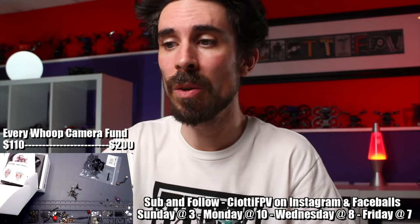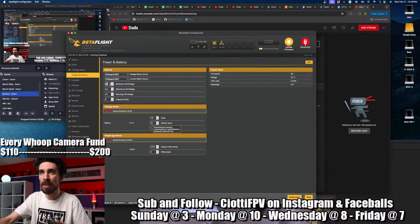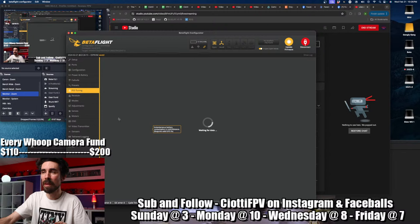I need to go into power and battery, and I'm just going to bump these up. Bump this from 2.9 to 3.0. Bump this from 3.1 to 3.2. I'm going to recommend everybody do that. That's going to keep you from punishing your batteries to death.